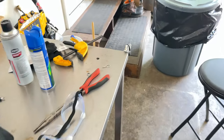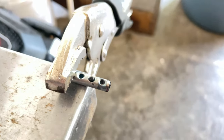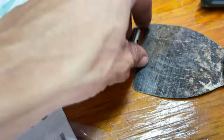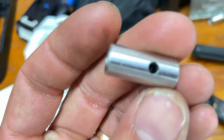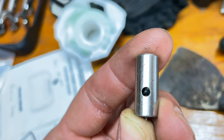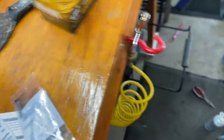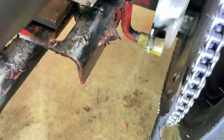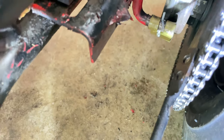I went back to the chopping table because the pin was too long, so I had to bring it down a bit. Another reason I'm doing this is because they come with this type of thing with a hole in it, and I guess you can put a cotter pin through and tighten it down. But on this type of go-kart, that hole is too small for it to go through.